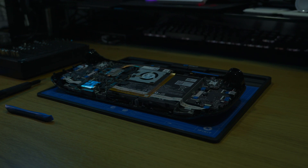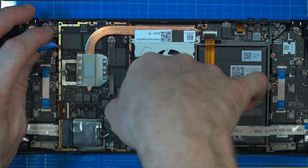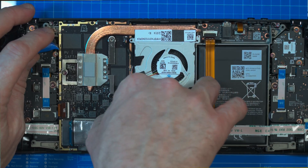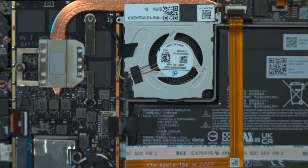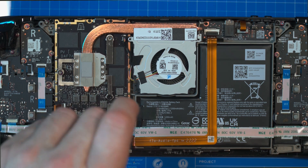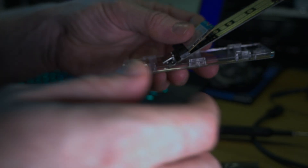This reveals the SSD drive and the battery connector. So firstly we'll remove the battery connector. Once the battery connector is removed, we can turn our attention to the SSD. There's a screw holding down the SSD — just unscrew this and then you can lift out the SSD. The SSD is in a little metal shield, just remove the metal shield.